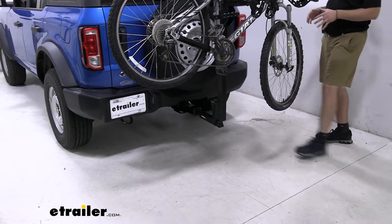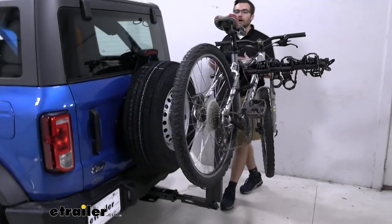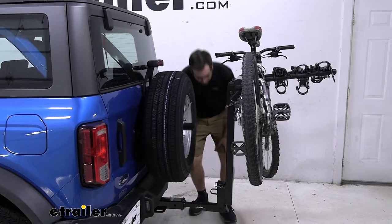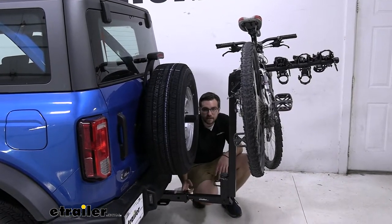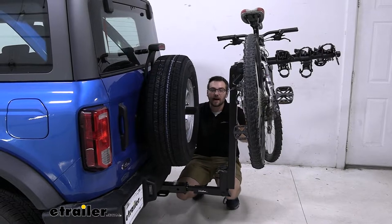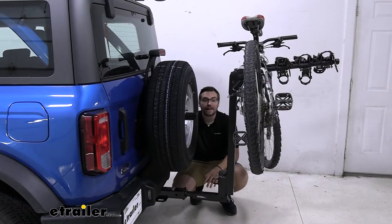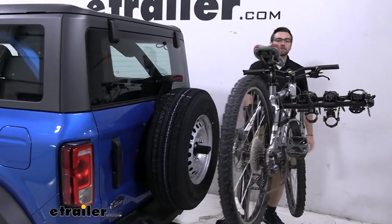Today we are on our Draw-Tite hitch, so we are going to be a little more extended compared to some other hitch options. If you compare it to something like the Curt Class 3, it just has a way shorter barrel, so you're not having this receiver sticking out all the way. You're actually losing about six inches from the hitch pinhole going backwards. With the Draw-Tite, that's giving us a ton of clearance to really get past this spare tire — that's kind of why we went ahead and installed it. If you're looking to put a lot of different accessories on, you definitely want that extension to help out.